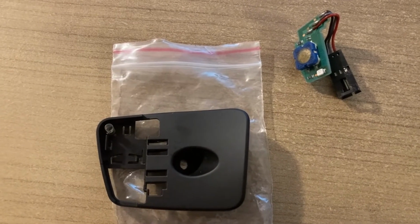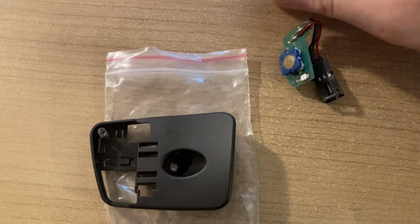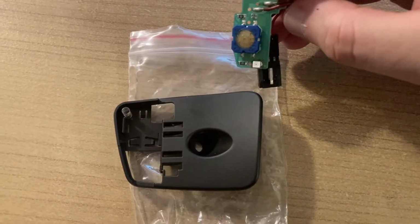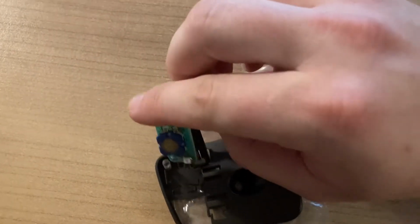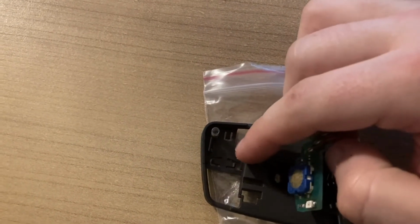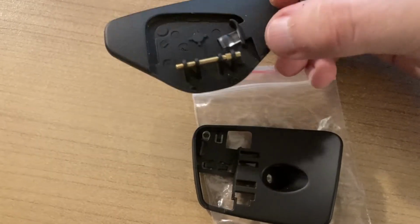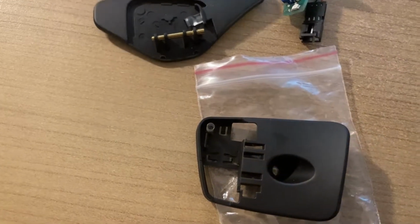And this is the assembly of the gear down paddle shift, the left one. Fairly straightforward. You figure it out easily which one of the 2 belongs to it. And what we're supposed to do is we put the electrical jack through this hole here. Then the PCB is gonna click on these plastic sides, and then we can put the button itself on the top and push the metal pin to close it up.